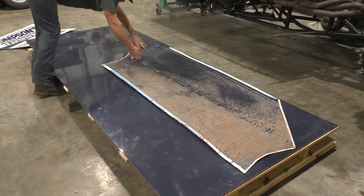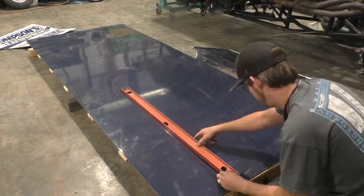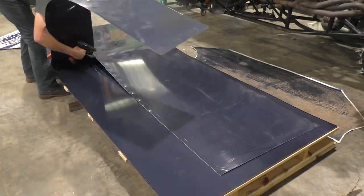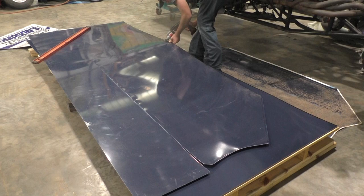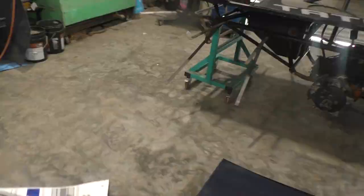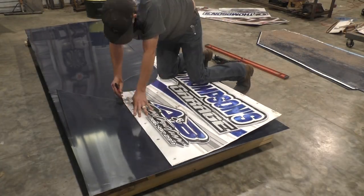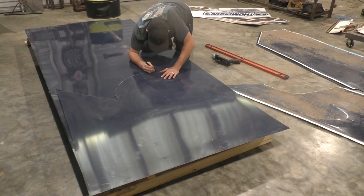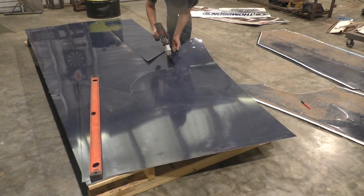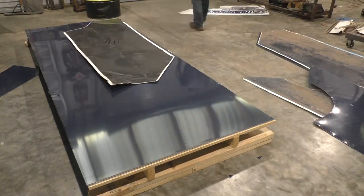Always start off, before you even go to cutting on a sheet of sheet metal, try to get the most out of your material. Lay all your sheets out and try to make it where you can get one door and one rear quarter off each sheet — that way it leaves you a lot of excess material for future fixes. Also, before you go to cutting, take consideration: you're going to want to add an inch on the bottom and an inch on the top, and probably a quarter to a half inch all around the other edges — the wheel wells and the little upright sides. That way you can hem it, gives you a little bit more structure.